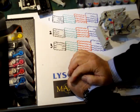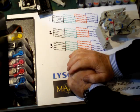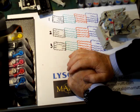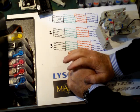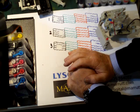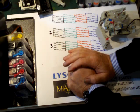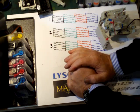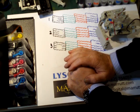Now step five: if there seems to be plenty of ink available in the reservoir and feed tubes, it may be that your cartridges are simply being starved of ink — either by the ink feed tubes being kinked, twisted, or compressed preventing ink from travelling up the line, or ink has managed to dry out inside the tube, which although extremely rare is nevertheless still a possibility.